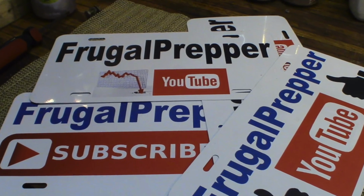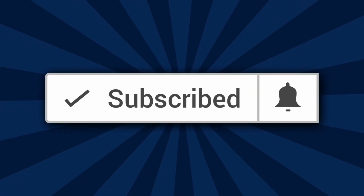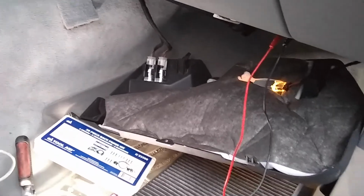It'll be off longer and on for a shorter period of time when it's on low, and then it'll stay on almost full time on high. And so we're going to take a look on the scope and see what we see. That is the blower motor connector. I am back probed into it, and I've got this running over to my scope. And so I'm going to see if I can set the scope up here on the laptop, and we'll see what kind of signal we're getting.